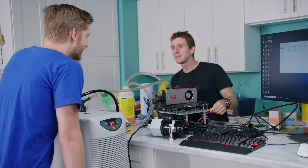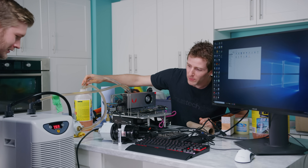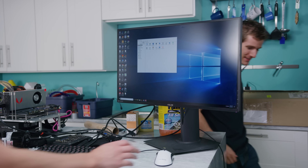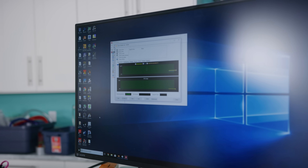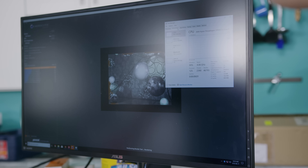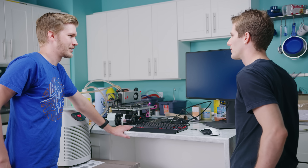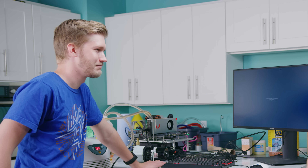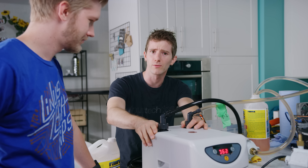And we're back to life! How many hours did we leave it for? It was fine after like three or so. Fantastic. So we're not going to go quite so low again. We're at 59 freedom units, whatever that is. And there's good news - it's currently at 4.1 GHz. Didn't change the voltage. We're at 19 degrees idle now, which is a lot more reasonable at this room temperature. Start with Cinebench. Over 6,000. Should we try for 4.2? It seems like a lot of the issue was just that your crappy SSD died - it might have not even been the condensation. I don't think we really need to run any more benchmarks to determine that this works really well.